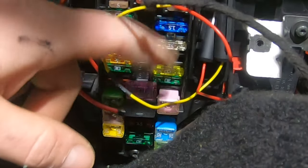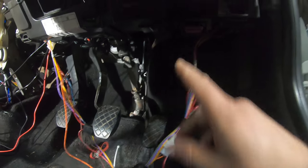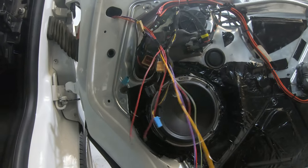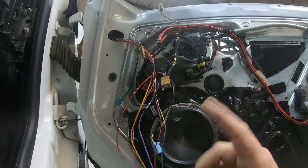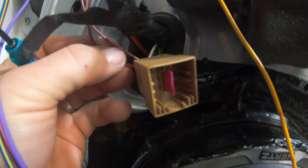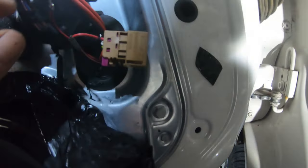There is a blue and yellow, a purple, a yellow, a red and white, and a black and white — all coming into the driver's door. On this side, the yellow cable needs to go to the switch; the others need to tie into the loom. The black and red goes into number 12 on this box, along with the red and white which goes into number 11.